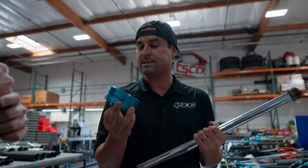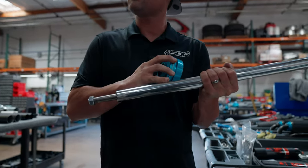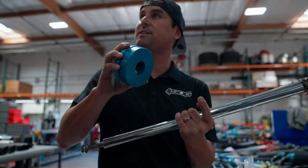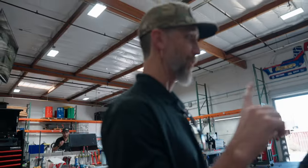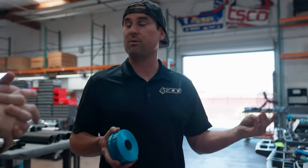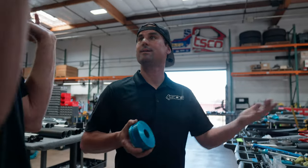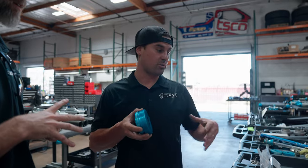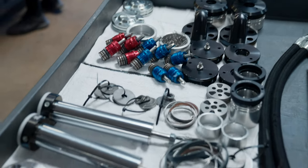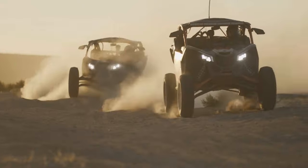Changing the bushing can actually help fix a minor ding — one pass might buff it out so it doesn't keep eating the seal. You don't want leaks because you're losing fluid, losing pressure, and eventually the shock just doesn't work. The oil and o-rings are designed to go a long way, but for a racer any important race is basically a reason to rebuild. We treat these like an engine — that's why we take them completely apart every time.